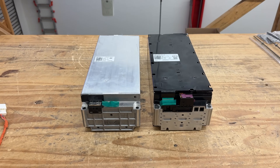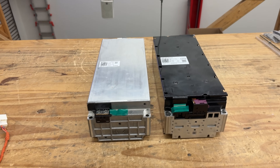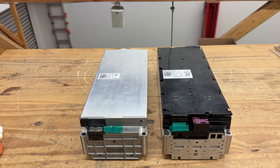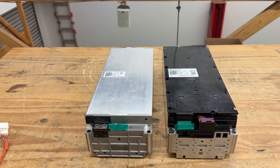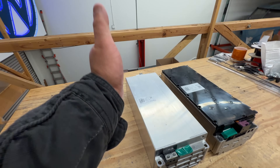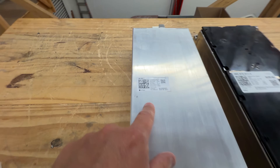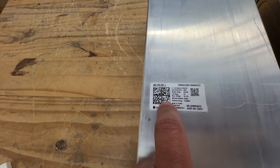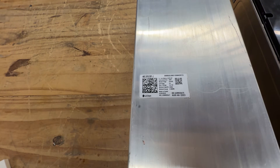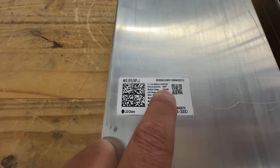Let's talk about batteries. This time we have another set that's a bit unusual. This battery module is the first one we have — two different versions from the same car, just different years with slightly different specs. This is an Audi e-tron module, and the early version has pouch cells inside and it's fully sealed. It's a lithium-ion NMC EV battery, nominal voltage 10.7V, configured 3s4p — three cells in series, four cells in parallel.